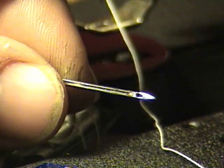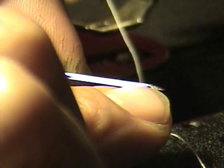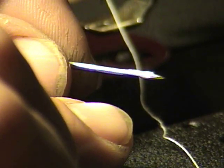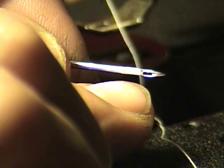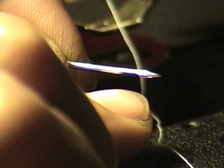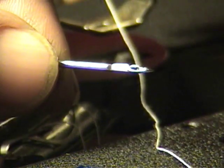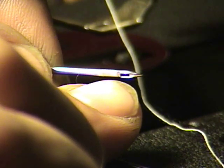This rides back and forth in this little shuttle thing down here. Now, this is a sewing machine needle — you can see this side has a groove on it and there's a little hole that the thread goes through. On the back side of that needle, you can see there's a little concave area right above where the hole is. That little concave area is where the needle hook passes through and grabs the thread out.